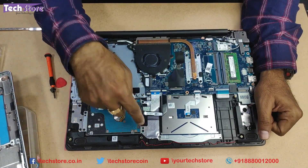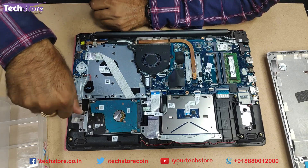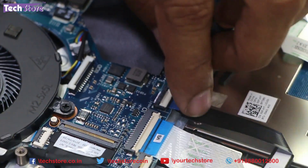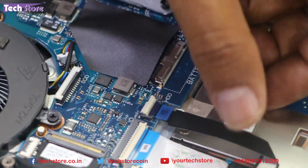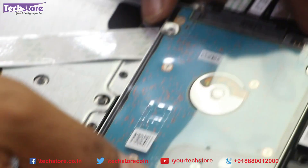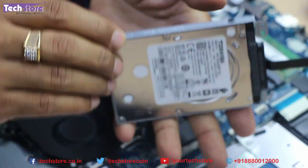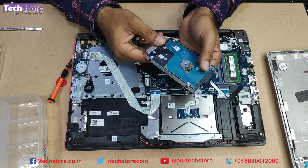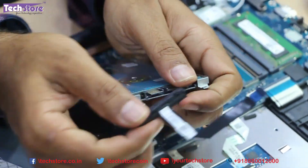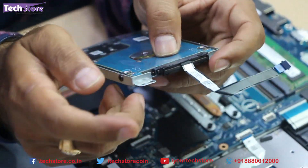The hard drive is over here - it comes with a 1 TB hard drive. Remove the connector first as it's a little delicate, then remove the 4 screws holding the frame. You can entirely replace the hard drive with another one. Just remove the notch carefully with your two thumbs, it will give away. Take another hard drive, put it onto the frame, and put it back.